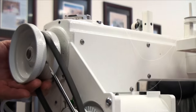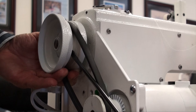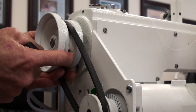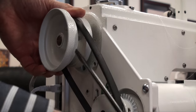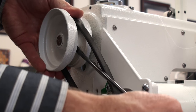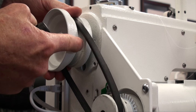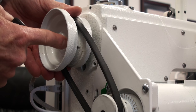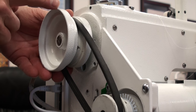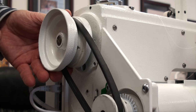Once we have that lined up, we'll come back and tighten the set screw just finger tight. We will back it up and tighten the other screw on the shaft — this was the first one in rotation, and it will be on the flat of the shaft. Now we will come back and double check the light to see if this is working.